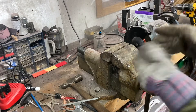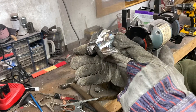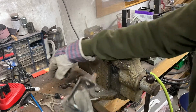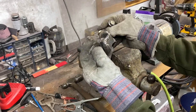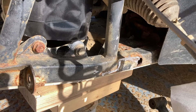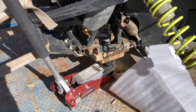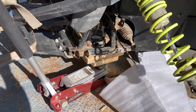I've got this thing close — I had to cut in several different places and re-weld and all that. Since the hole was still stretched out from the wreck I better re-drill it, so I need to put the control arm in there with the bushings and run a bolt through it to make sure all the holes line up, then we'll see about getting it welded back on. First thing to do is grind all that weld off where I ground the bracket off the frame, get that nice and smooth, then get the bracket welded on. We've got to make sure the lower control arm fits in that bracket before we do any welding.